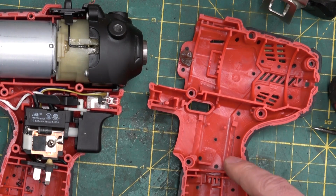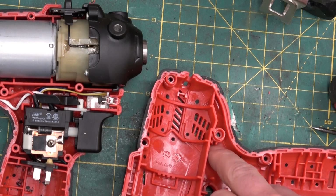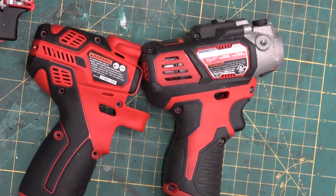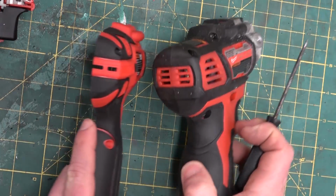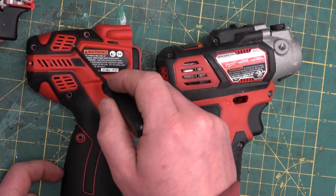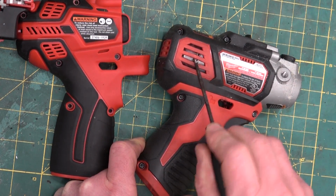Maybe quite a bit more shots in here, had some polishing issues at the ejection pin points, a little bit rougher surface finish on the mold itself in some of these compound radii. But more detail on the air outlets, air intakes being on the back side here. A little small air intake, but lots of room for air to egress, and we have some diagonal gusseting here to stiffen that up and prevent the ingress of fingers on the Milwaukee. A little bit bigger, but they're so thick you wouldn't be too worried about breaking them out.